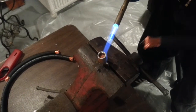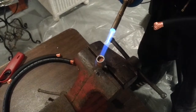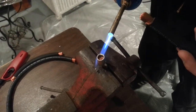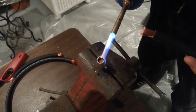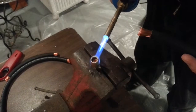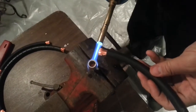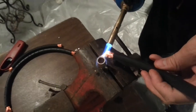You want to heat this up — when it's ready it's gonna start bubbling. When it starts bubbling, bring your cable in and just heat up the copper a little bit before inserting. Depending on your cut, one end might be a little longer and one end might be a little obtuse or flaring out a bit. Start by inserting that end into the hole, then follow up with the much cleaner side.